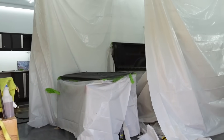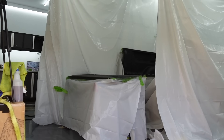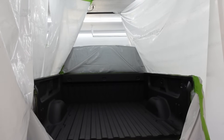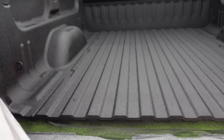I'm done. Fresh air. It's a good-looking truck. All four bottles are applied - it went on really well. It looks really good right now. I actually do need to get in there and take off the masking tape before it hardens up, because once it hardens up, good luck getting that masking tape off. You actually do take it off while it's still a little bit tacky. My makeshift paint booth worked good, not great. There is still a lot of overspray and I'm kind of worried I'm not going to be able to get it up. Yeah, that got everywhere. But dang, that looks so dang good.